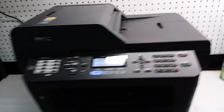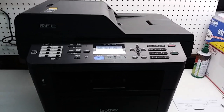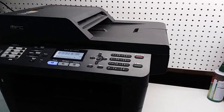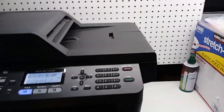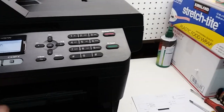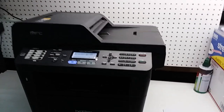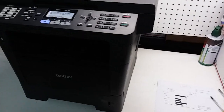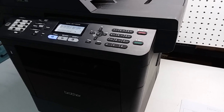If you have blurry prints on any of your printing pages — especially the first one that comes out — the indicator is that your fuser sleeves on the roller are going bad. This is a very common case on Brother printers that use the TN720 or TN750 toner cartridges. For some reason they had an issue where, after over 50,000 pages — sometimes under that — it starts producing blurry prints. To check it, just print any page and it will show you if the blurriness is due to a bad fuser.